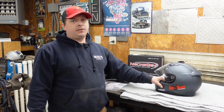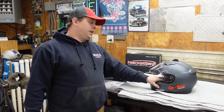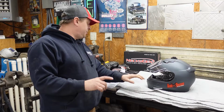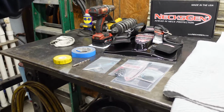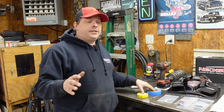We are in this video going to tell you how to get a little bit more life out of these older helmets that are still in spec, but you need a Hans device to use. By that I mean this helmet does not have the Hans anchors, so we're going to show you how to drill those. We're going to also show you how to install the hardware, and then talk about the Necksgen harness that we purchased. All right, so a couple things you're going to need to get started.